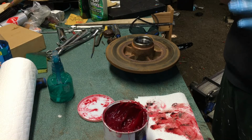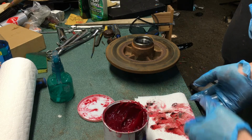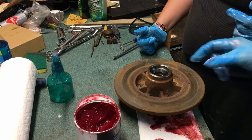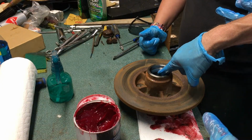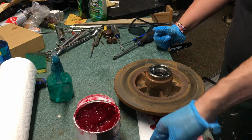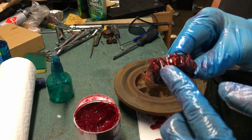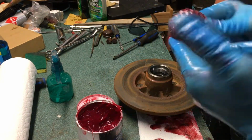So you've done all your hard work and you've got your bearings now repacked with grease. So what we're actually going to do now is take our rotor. Now, what I've done off camera, and I haven't mentioned, but I will here, is we want to also lay your peepers on this thing. Make sure there's no cracking or discolorization on this outer race of the bearing here. And same with the bearing. You might not know what a normal bearing looks like, but you will know if it looks cracked or broken, or if one of these rollers is gone, or something along those lines.